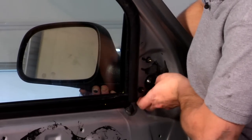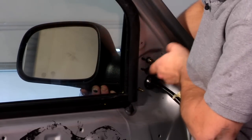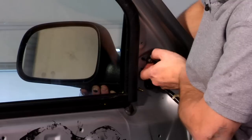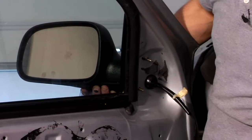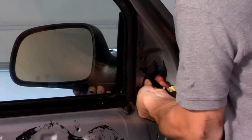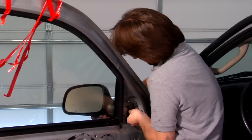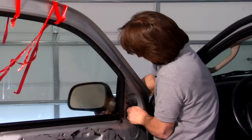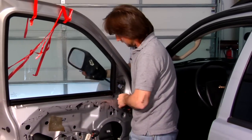It's really not that difficult — you can do this in your driveway. No sense paying a mechanic for this one. Just try not to lose them. Get your three nuts off here and make sure you set them somewhere so you're not going to lose them. In this particular mirror, since it's a power mirror, it does have a harness that goes through, so you'll have to work with that and get it out also.